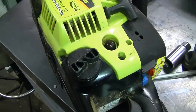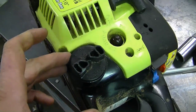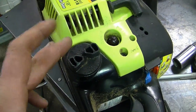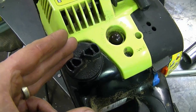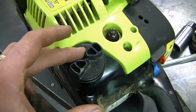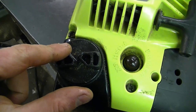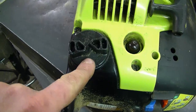Here's a tip: some people say they can't take the gas cap off their chainsaw and wonder if it's the tank or the gas cap. My answer: replace the gas cap. Sometimes people file down the threads so it goes in easier, but just buy a brand new cap and you'll realize it goes in much easier. On this chainsaw here, I need a pair of pliers to remove and replace the cap — so this saw will definitely be getting a brand new gas cap. That'll be it for today's Q&A, guys. Thanks for watching, make sure to subscribe, and have yourselves a great weekend.